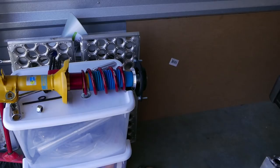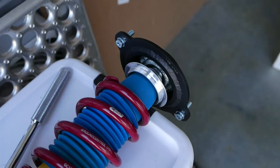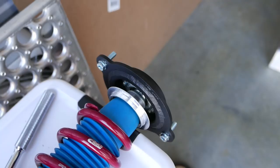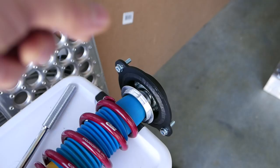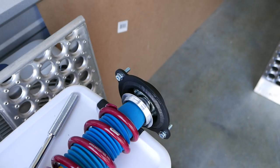I'm putting on the Silver Project upper strut bearings and the only thing I needed to do to make it work properly is add a half-inch heavy-duty washer on top of the upper perch because they didn't line up perfectly. The spherical ball end is a smaller landing area than the OEM unit, so it didn't work with the Ground Control upper perch.